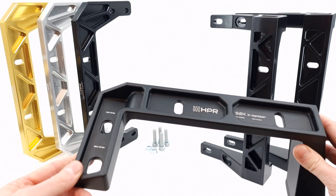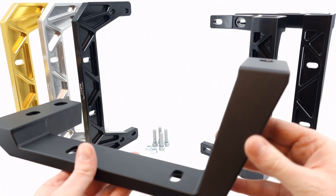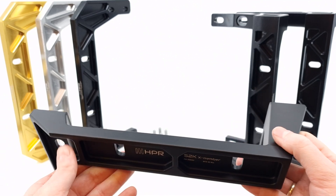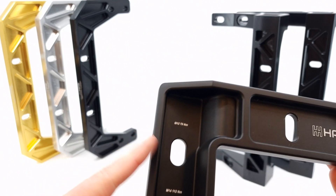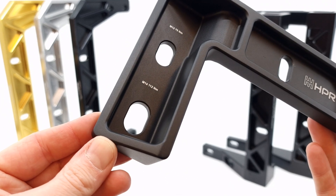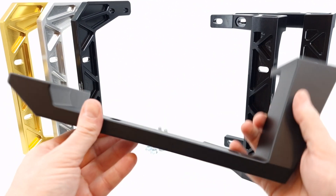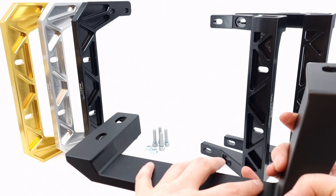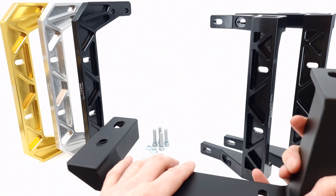It's a large piece CNC machined out of one piece billet aluminum. All the material not needed in the design has been milled away to keep the weight down. We also laser engrave the bolt size and the torque needed for installation. This one works with both the B57 8HP model in conjunction with our rear mount, the Ultra Flex rear mount, and the N57 8HP and the DCT model.